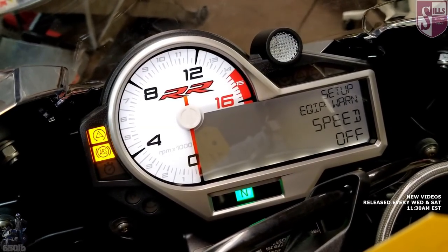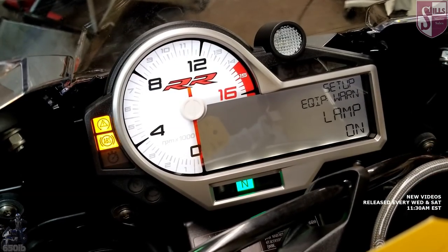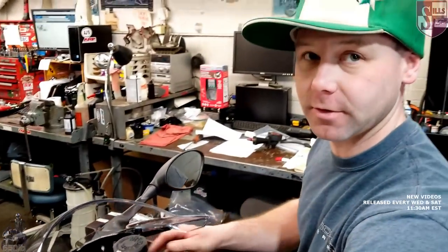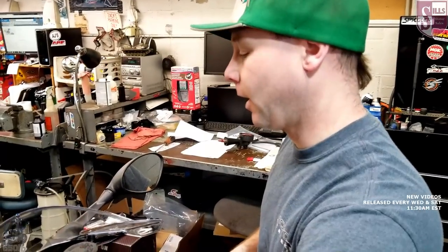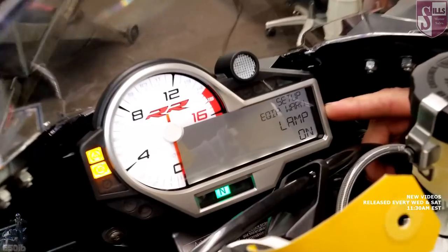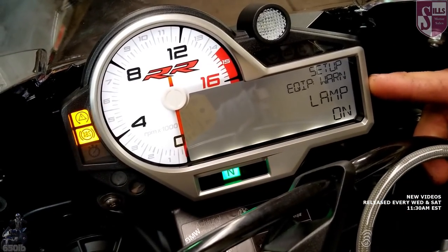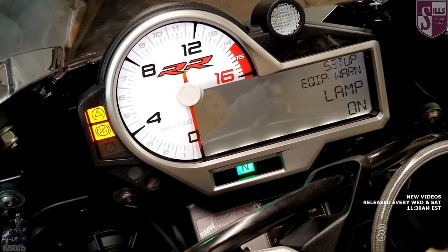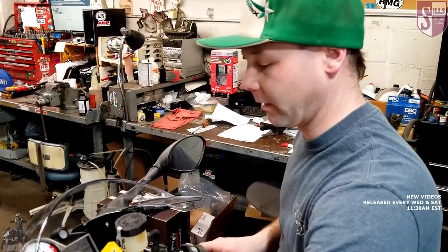This lets you know if a headlight bulb is out or your license plate light is out — it'll show 'lamp' on the screen with an exclamation point and an arrow pointing backwards or forward to indicate which direction to look for the faulty light. The reason they have an on/off toggle is that when the lamp warning is on, you lose your engine temperature reading. At the racetrack, when we disconnect the headlights and taillights, that lamp warning would always be on and you wouldn't know your engine temp — that's why you're able to turn it off.